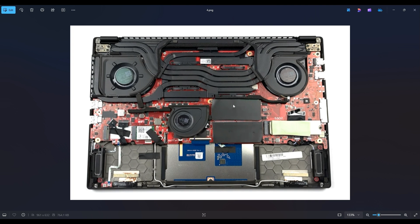These are your two RAM slots right here — two SODIMM slots, DDR5 RAM. This computer takes a total of 64 gigabytes of RAM. Below in the description, in that link with all the replacement and upgrade parts, I will have several different options for RAM replacement: a single stick if you just need the cheapest replacement, a 32-gigabyte kit with two 16-gigabyte sticks, and a 64-gigabyte kit with two 32-gigabyte sticks to fully max out your RAM.